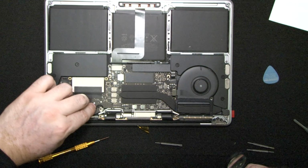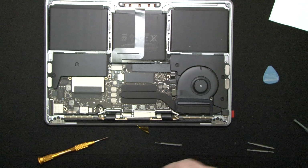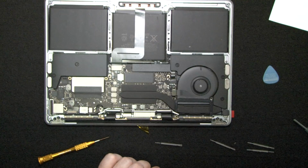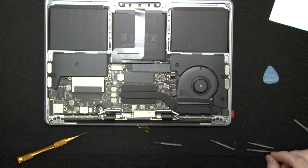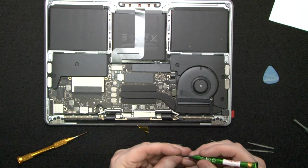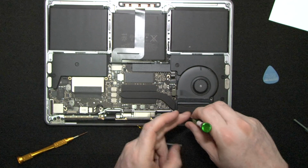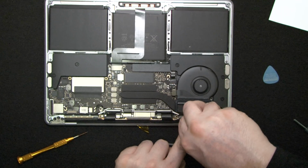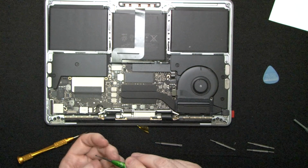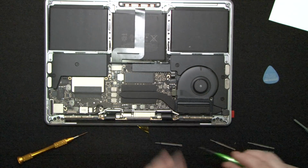So Apple says we are not going to use any circuit boards that are separate from our logic board. Put everything on board, basically. Now there's plus and minus in that. The positive to have the logic board all inclusive is there are fewer connections. Fewer connections, fewer things could go wrong. That's positive. Negative, if something goes wrong, you throw away everything.